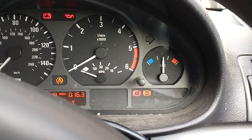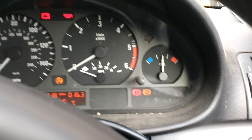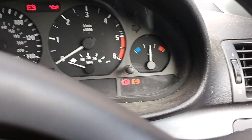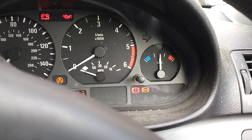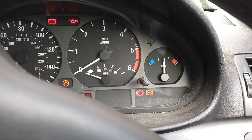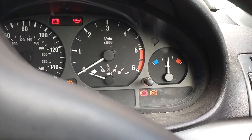This is another demonstration using the PicoScope on my car. The ABS fault light is on — I've induced this fault myself by disconnecting the front driver side (front right hand side) ABS sensor. What I'll show you here is how to use the PicoScope to see what kind of waveform you get out of this circuit.